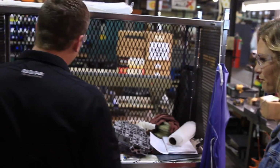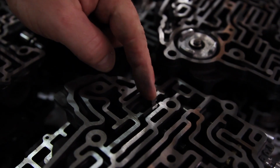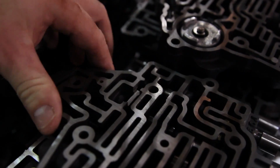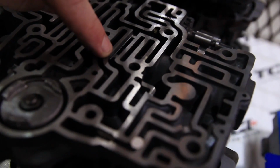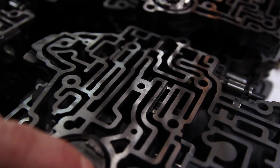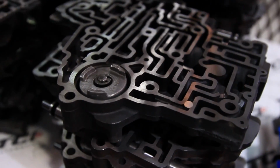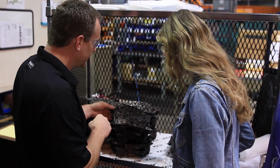This is the valve body department. All right. The valve body, like you said earlier, is basically the brain of your transmission. The brain of the transmission. Yep. Your valve body is what's going to dictate where the fluid goes to apply the clutch packs. So your front pump spins when your motor's running, that's circulating the fluid, and then this fluid runs through. Common term, they call it the worm gallery. The worm gallery, yep. That's awesome. Because it looks like a worm farm, all it does is the little grooves and passages.